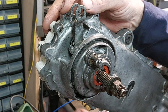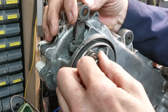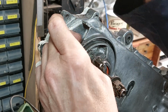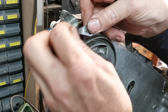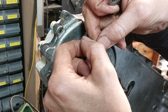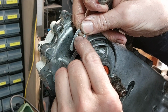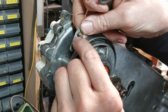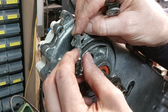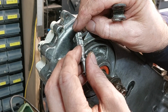Moving on. Right, so I've cleaned all the rear brake parts and defurred it, and it's all gone back together quite nicely. I just thought you'd like to see, it's quite involved putting it all back together. So what you have, like on the front, is the old wear indicator. The arrow's a bit furred up there, you can't see it. And like on the front, it's got a big lug compared to all the smaller splines, so it can only go on this shaft one way. Quite obvious, there. Goes on that spline there to line it up.